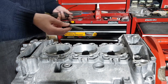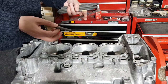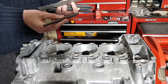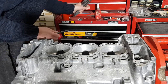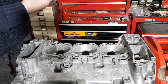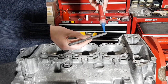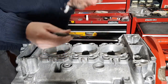The next job is to fit the head studs. These have all been cleaned up ready to go in. They need to be inserted to a depth so there's 150mm sticking up, so I'm going to measure with a rule and put them in one by one. I'm going to put a little bit of Loctite on the bottom of them so they don't move when putting the threads in. The Loctite I'm using is 243, which is a medium strength, vibration-proof grade — not looking for huge strength, just to stop them spinning. They insert quite a long way so I'll put a little bit near the bottom and measure each one as they go in.